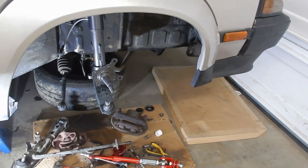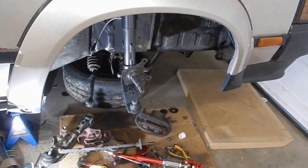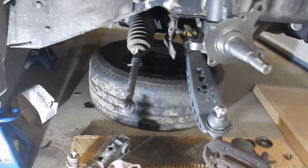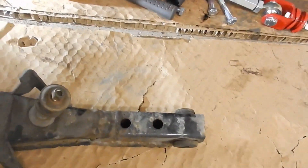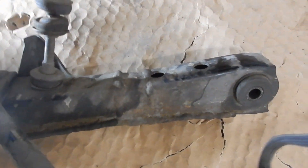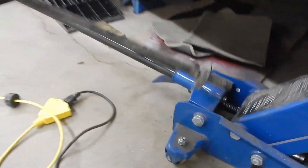I've removed the front suspension. The only thing I left in there was the tie rod — so far the tie rod is in really good shape, so I'll leave that, but I've got a new boot coming for it. Thank God for Rock Auto. Have a look at these old arms: looks like somebody's done some welding on there — cut them, added about an inch, and welded it. And they're not straight either, which is kind of concerning. So we're going to be chucking that.